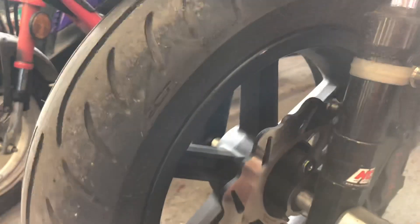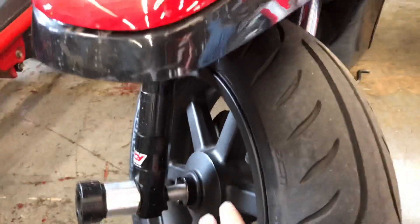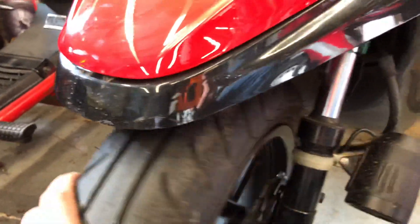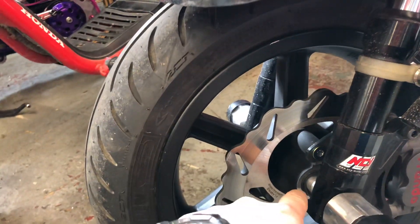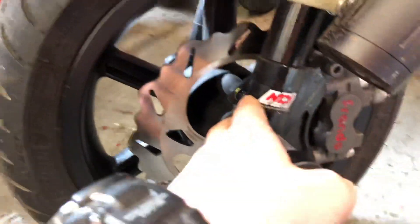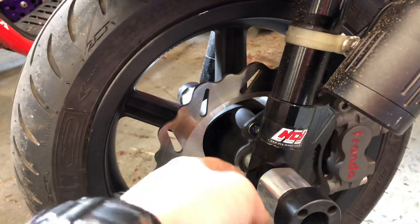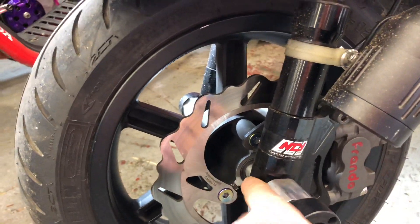Same with wheels — your Taiwan wheels are going to be a 12 millimeter axle as well. So make sure when you're putting your stuff together and doing your setup you really need to lay it all out and make sure everything's going to work. That's why I tell guys it's really easiest to go with 12 millimeter stuff. If you end up getting a wheel that's a 10 millimeter axle, we have spacers that fit in here and fill in the gap between the 10 and 12, so you can use a 10 millimeter axle on 12 millimeter legs if you use our spacers.